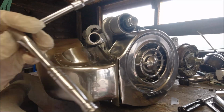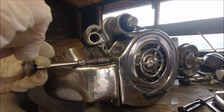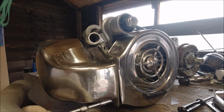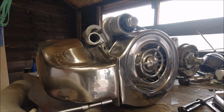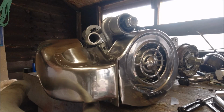And if you noticed, I'm only using a small ratchet for the exhaust because it's dead easy to over tighten them nuts on the bottom and shear them. They only need to be, again like these, tight, and maybe a 1/4 tighter. That's perfect now. That's on. So we've got our cowling on, spark plug.